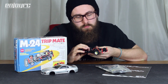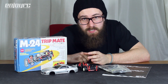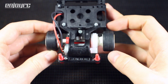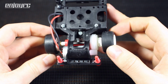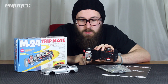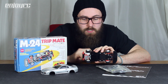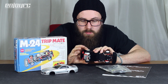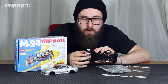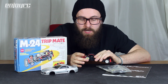Because, like I said, it's a pancar style chassis, it has a solid rear axle with a diff and basically a floating motor pod in the back with a fiberglass H plate, as you can see here, which is very similar to what you would see on a Kyosho Mini-Z. So basically the rear axle can twist and flex up and down just on this fiberglass H plate. But again, the axle is solid.